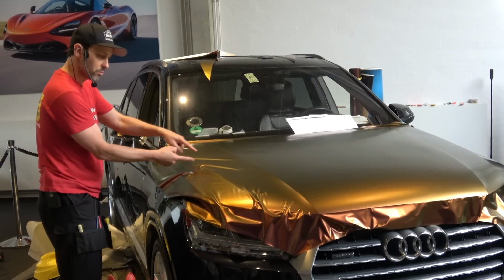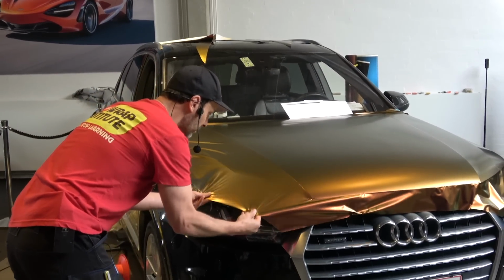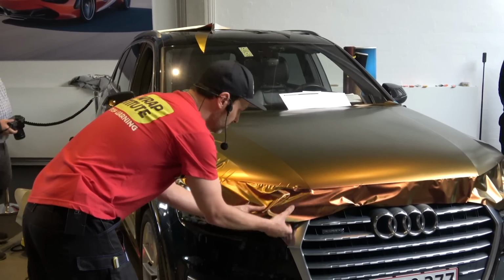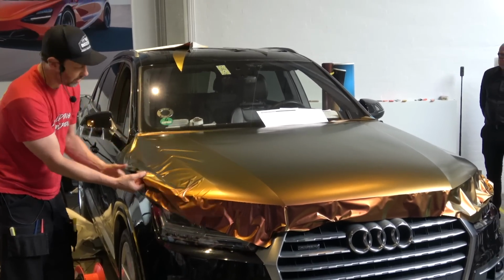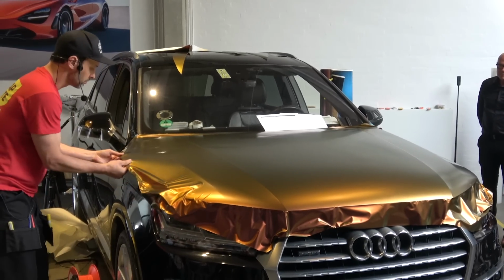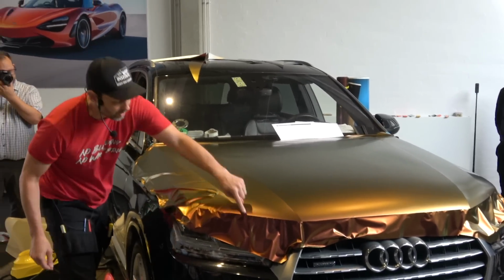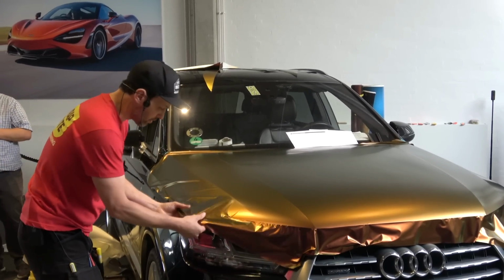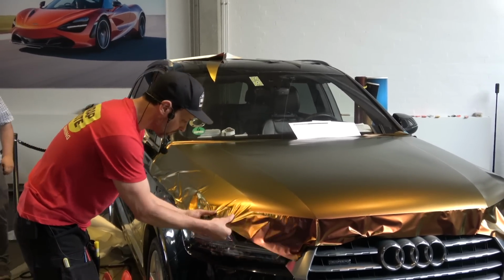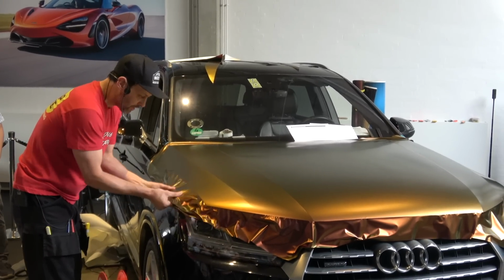Where does the material want to go? Cool. So I pick it up here, I give it a shake, tack it, tap it. Ah, wants to go here, so I'm going to pull here. It's going good so far. Cool. Once I get it to this body line, I lock it in on the body line. Then I go, same thing. Make my bed, lock the corner, pull that tension out just enough. Pull to the outside. Cool.